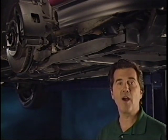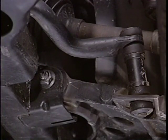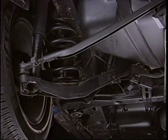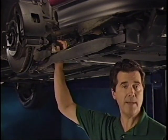The 1997 Park Avenue suspension is based upon the current series Riviera suspension, using either the base Dynaride or Grand Touring suspension. With Dynaride, the front stabilizer bar is hollow and is 1 millimeter smaller in diameter than the Riviera. The rear bar is 1 millimeter larger in diameter. Also, the spring rate is 25 newtons per millimeter softer than the Riviera. With Grand Touring, the front stabilizer bar is the same diameter as the Riviera. The rear bar is 3 millimeters larger in diameter, and the up-level suspension spring rate is the same as the Riviera.